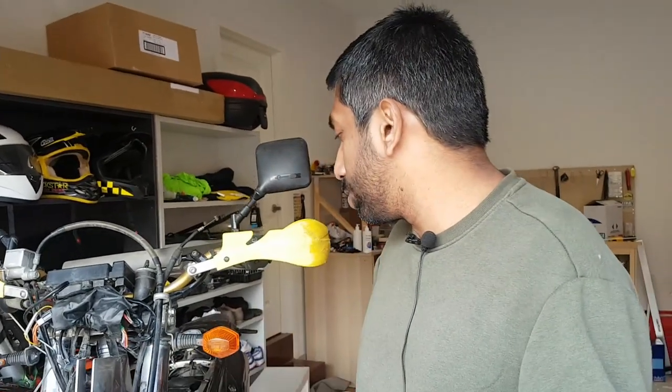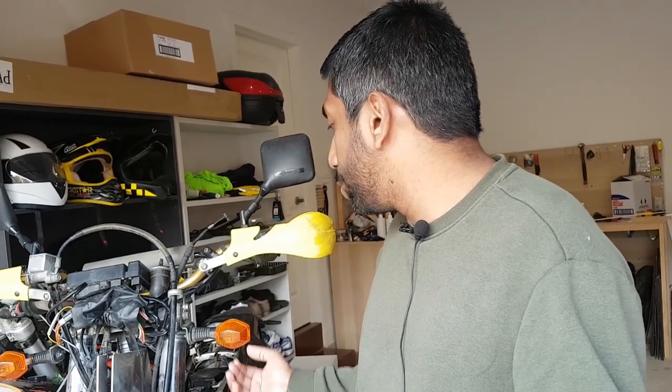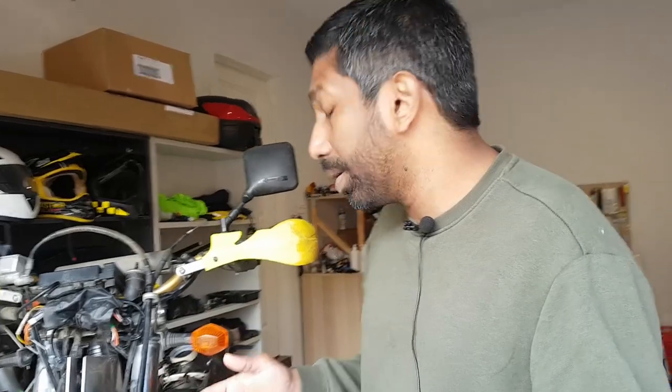It's a bit more difficult to design because you need to make sure that the brackets extending from the frame don't collide with the forks or the triple clamp, and the wiring needs to be neatly tucked away to keep it from chafing against other components. I started off by taking everything apart, measuring the bike — the distances between bolts, how far things can extend — and drew up a couple of templates. The templates went from soft cardboard, then harder cardboard, then MDF board, and after getting the MDF sorted out I decided to go with three-millimetre aluminium. Meanwhile, Devin was taking a more high-tech approach, drawing up his tower on his computer with a pretty intricate design so the tower looks awesome.